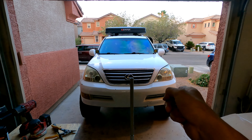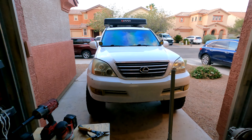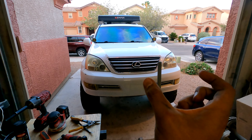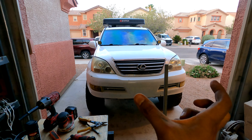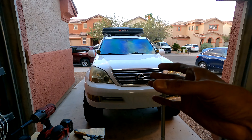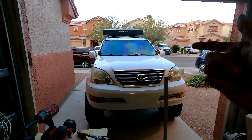Both sides of the GX are done, so I'm going to call it for the night. I took it around the block and it's driving around just fine at full articulation, still rubbing a little bit. So instead of the body mount chop being about a 3-inch cut, I'm going to extend it to about a 5-inch cut — that way I won't have to do the full body mount relocation kit where you cut off the entire body mount and relocate it further back. Anyways, that's going to do it for today. Like, comment, subscribe — stay tuned for more content and join the ride.